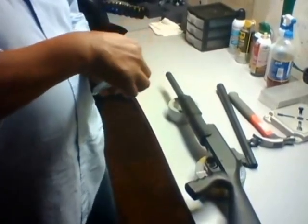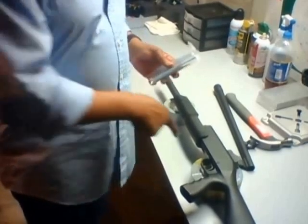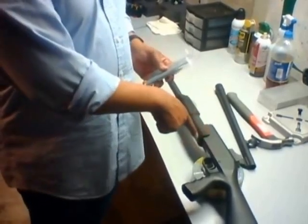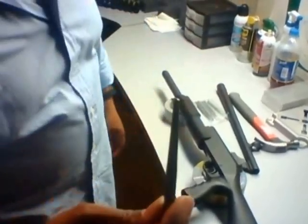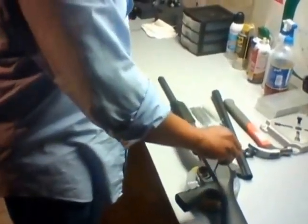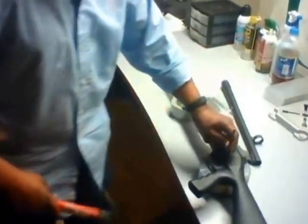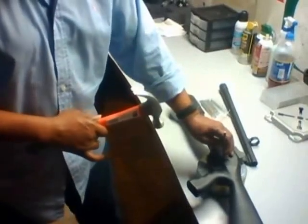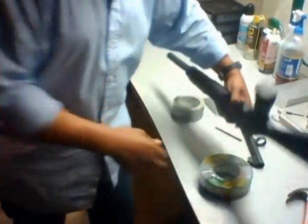Because it has that, there's actually a punch that you can use that's really good for that specifically. This way you're not using your flat punch and either flattening some of that out on the inside of there or rounding the edges of your punch. And that's going to be this punch right here. I don't know if you can see it better like that, but it's rounded. And it fits perfectly in there. So we're going to go ahead and tap this out. We're going to see what happens. Like I said, I'm going to stop this video in a minute. That's tapped out. So we were fortunate.